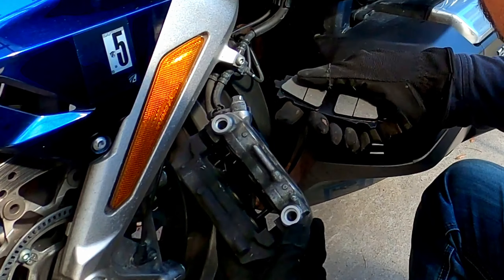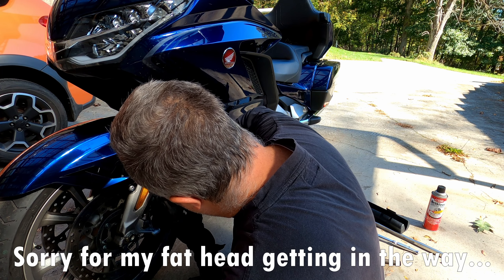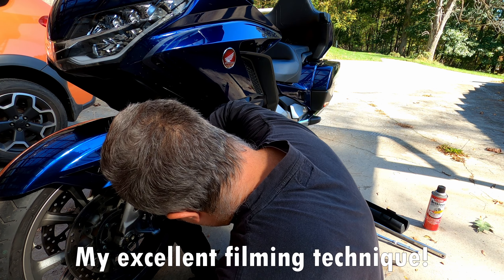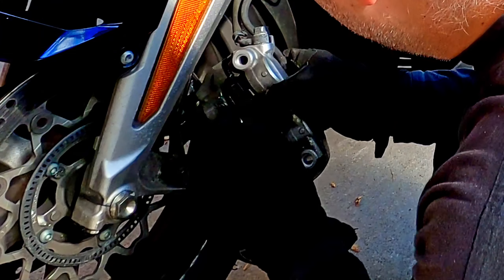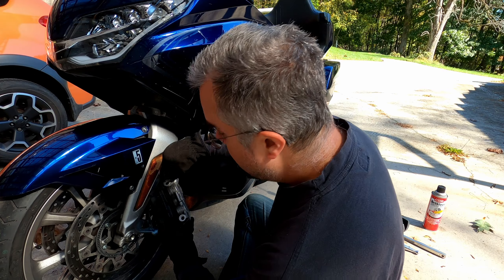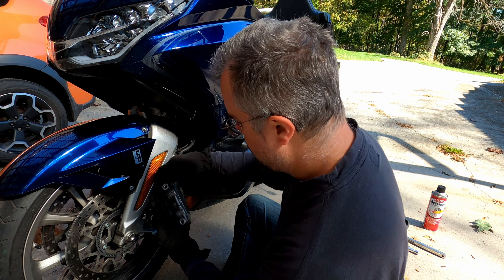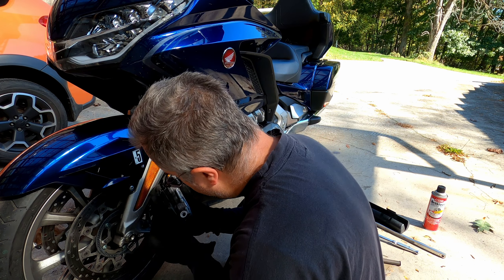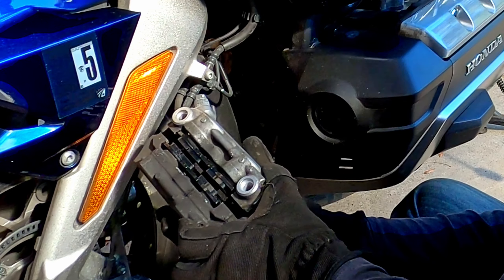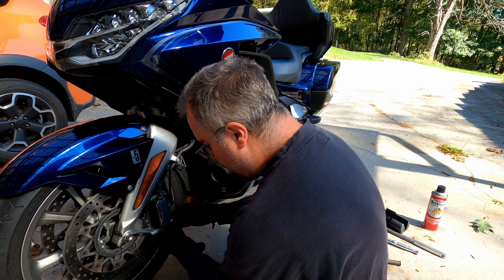On the brake caliper, one side has pistons, one side doesn't. I'll put the pad on first on the static side — no pistons. There's a little spring clip down there, so you just got to work the pad down, push it down at the spring pad, and then work those tabs into the channels. This is probably the hardest part of the whole process. If you put the tab in at the top end of the caliper first, there's more of the spring clip there, so work from that side first to make it easier. Now hopefully it fits back on the rotor and we can tighten it down. I'll start one of the bolts to hold it in place.